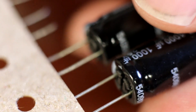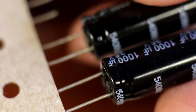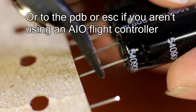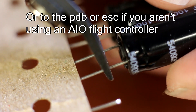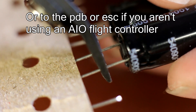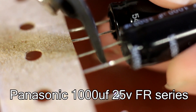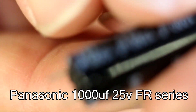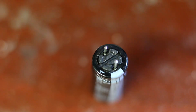In this video I'm going to show you how I solder wire to a capacitor for adding to the flight controller. Cut the leads short a couple millimeters. If you have room you can leave them a little longer, but it ain't gonna help none. Cut them short. You gotta tin them.